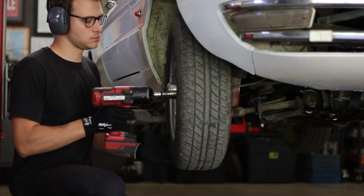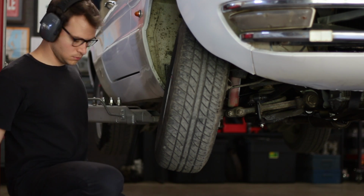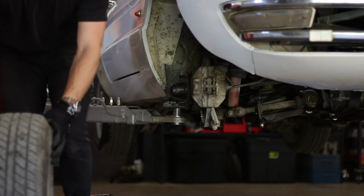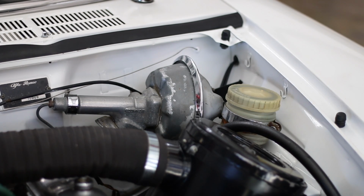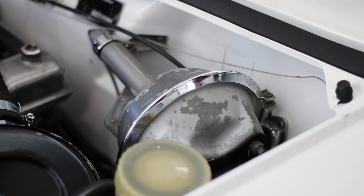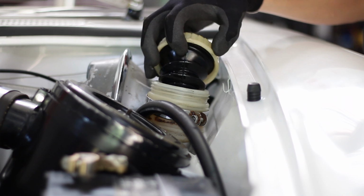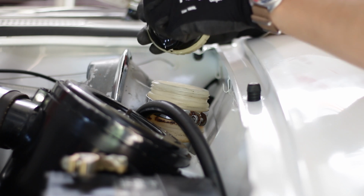A standard 1600 Duetto Spider would have ATE disc brakes all round. Single circuit, exactly the same setup as my 1300 Ti. But this Spider has a dealer-fitted vacuum booster, just like the twin car I rebuilt back in 2020. There was a batch of right-hand drive 1600 Spiders ordered in 1967 that went to South Africa and were all fitted with boosters at the dealership. This is one of those cars.